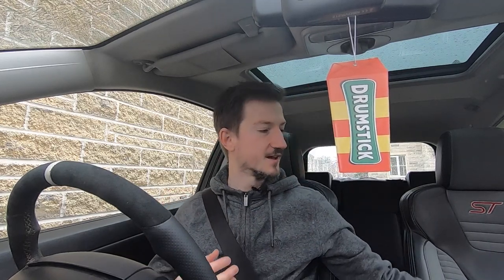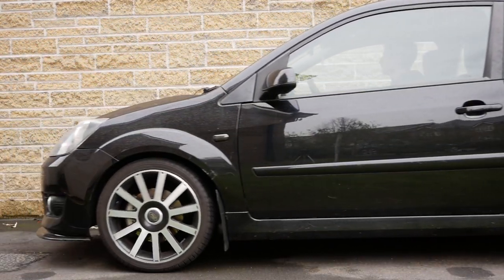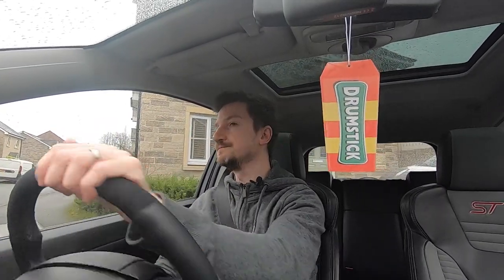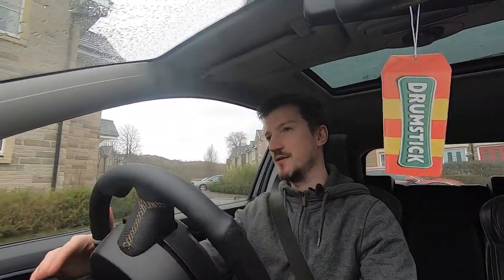Just thought I'd do a quick follow-up after the installation. I've got my camera down on the seat with the mic plugged in so I can splice the audio over the video, because the GoPro audio is shocking. This is after I've already got home and done a bit of a drive. I found something out after my initial drive — you actually need to bed the pads and discs in, because they're brand new, and with these EBC ones you do need to bed them in.